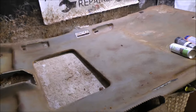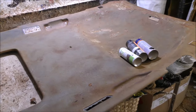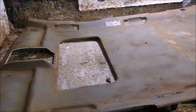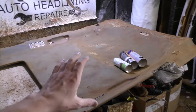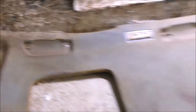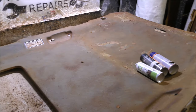This headlining board needs to be cleaned down. This car is a Volkswagen Touareg — one of the more expensive era of cars we usually work on. If you were to buy a brand new headlining board as a donor for the recovery stage, we hear from Volkswagen that these can cost from $1,000 upwards. So we're just going to have to sit down and sand off that glue. They also added glue up around the front near the grab handle, so you can see it doesn't work — it looks messy. It would have been more ideal to just put drawing pins in and then bring it to a trimmer when ready.